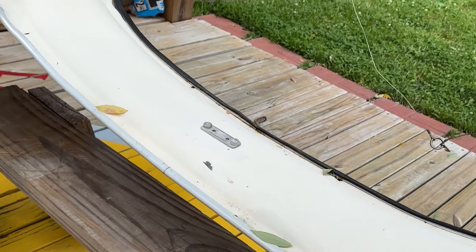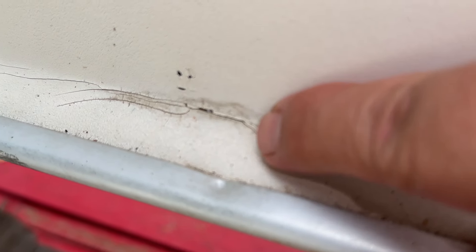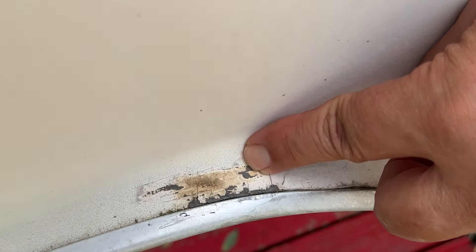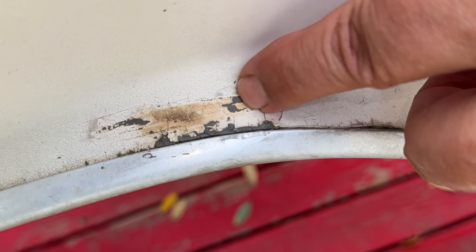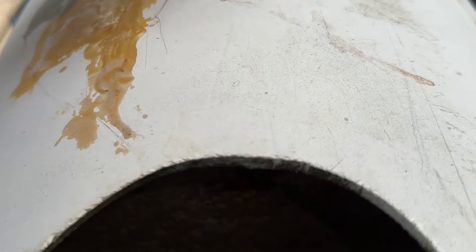When we come back out again we can look and see there's actually a damaged spot right here where some gel coat is chipped. The gel coat's chipped, so there's actually water getting into the boat there. If you start to look around, you can find other areas where the gel coat — this little white material — is gone and you start to see fiberglass underneath. That fiberglass, thin like it is on these boats, can be cracked and water can go right through it.